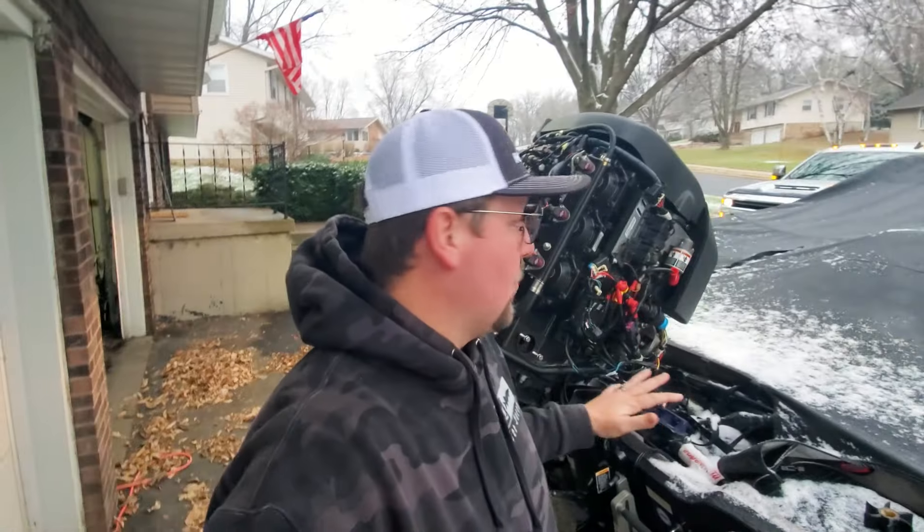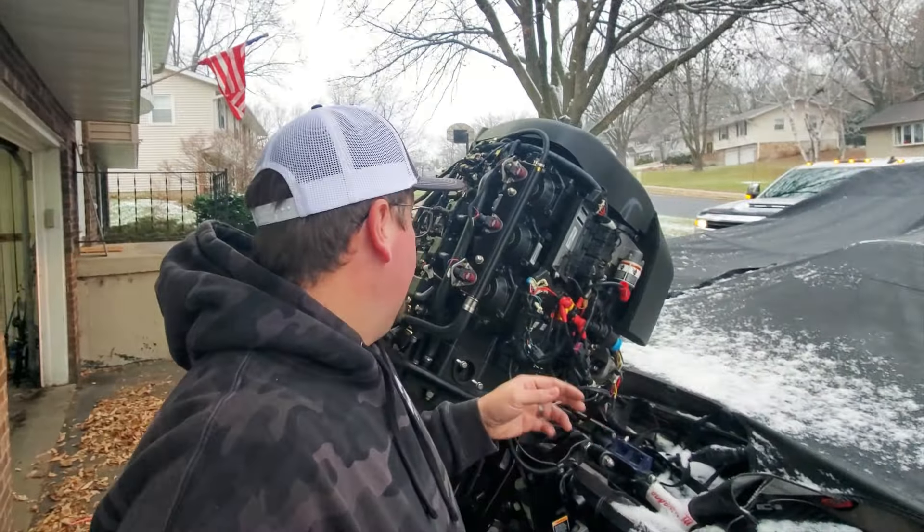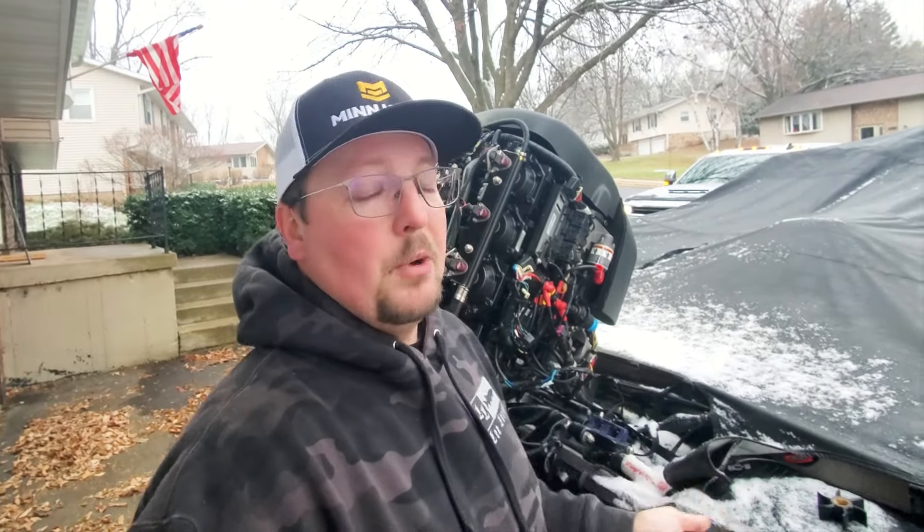So it's got to be the poppet valve — that's pretty much it. I'm not a certified marine mechanic, just doing some troubleshooting. The poppet valve is the only other component in the cooling system that could be causing this, and there are very few videos documenting this especially on the OptiMax 250. It can happen on any outboard — even inboards and stern drives have poppet valves. So: start with the simple stuff — thermostats, water pump — and if all else fails, check the poppet valve.